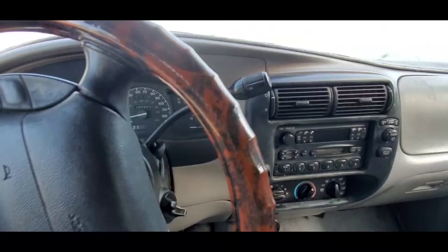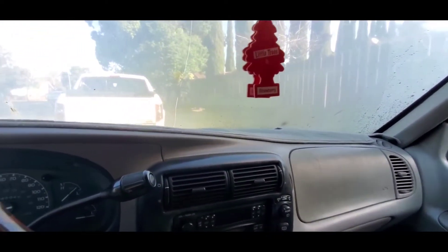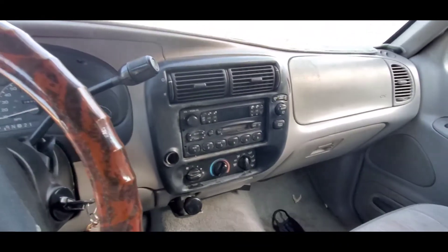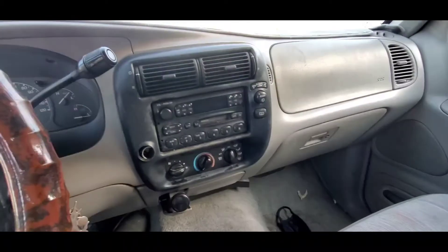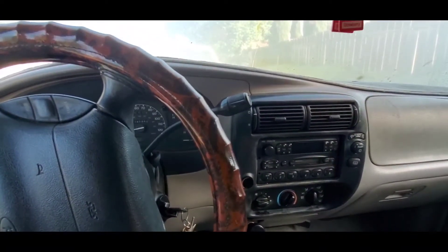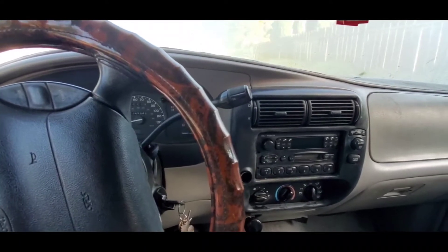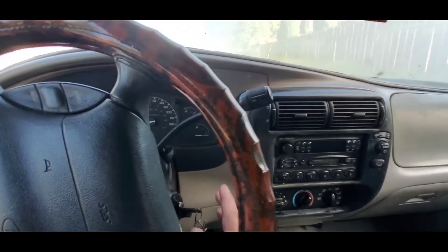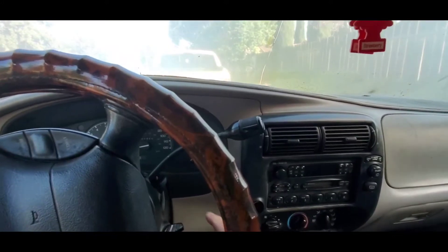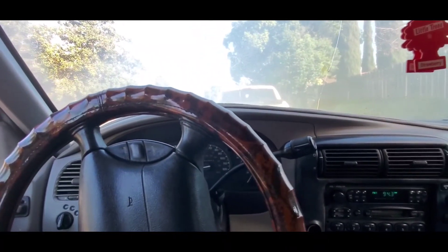The car has been parked here for two days because the owners were busy and couldn't pick it up. You can see it's foggy — a lot of moisture on the windshield. It's been sitting for over 24 hours. I replaced the plugs — you guys saw in the other video how bad the plugs were — and the idle control valve and the fuel cap. The problem was it would take a long time to start, three or four tries with long cranks, and then even when the car started the guy told me it would die again after driving a little bit. Let's see... oh, that feels good! Turned right on — it seems like it's working.